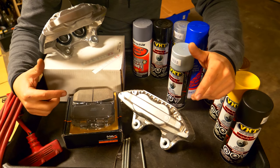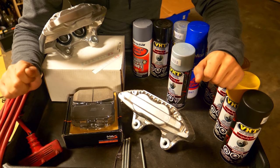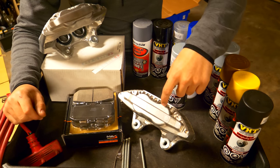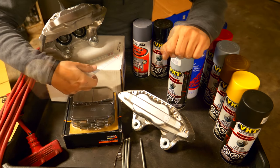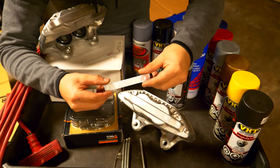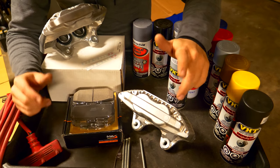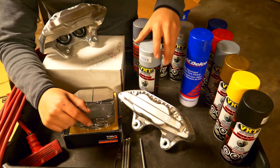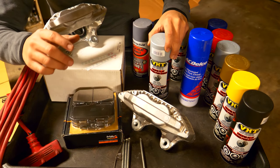I am very detail oriented when it comes to my cars. Now this upgrade kit that I'm going to be doing — every part that I have right now I could just go ahead and install. But what I'm going to do first is clean up these calipers, shave off any of the castings that are really visible, paint them up, make them look perfect. I'm also going to be putting some Nissan Motorsport stickers on the caliper to give it a little bit of extra detail. I'm going to be using some brake cleaner to clean up my new brake rotors, and I'm going to coat them with a little coat of paint to prevent the rotor hat from rusting.